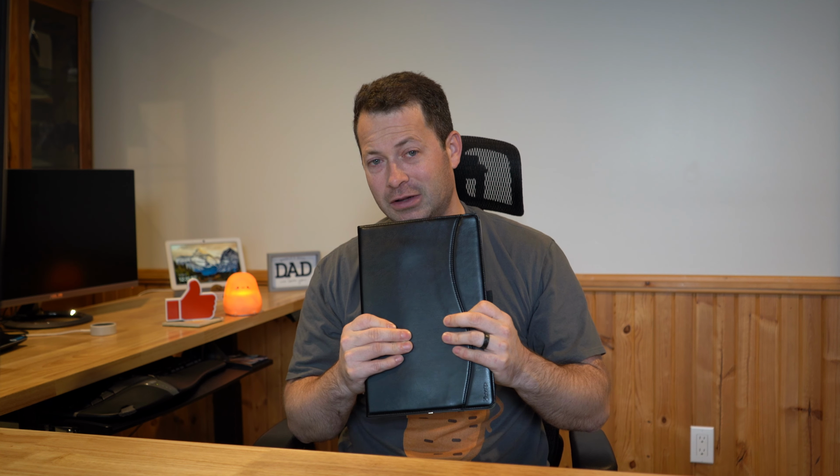So I guess I didn't clearly mention it in the past, but when I have 6 WANs in load balance, I don't get 6 times the speed on any single device. Instead, you get 6 times the bandwidth, which is maybe a little bit confusing to some. That means that if I had 6 of these tablets, in theory with equal ISPs doing load balancing, I could have all 6 tablets each getting 300 megabits per second at the same time. And if I just tested one, it would still only get 300 megabits per second.